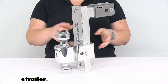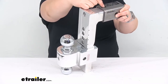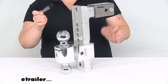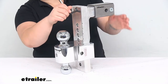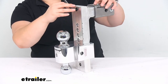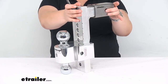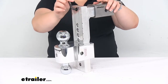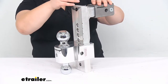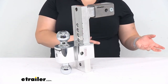At the top of the shank going into your hitch receiver tube, there's a little post that will pop up into your hitch and provide some anti-rattle. You operate that with the included Allen wrench — you just turn it to the right to bring it up. So as you put that into your hitch and secure it with a hitch pin and clip or lock, you push that little button up and that gives you the force you need to make sure everything stays in place, so you don't have any rattling. It also eliminates some of the transfer of motion from your trailer into your towing vehicle.